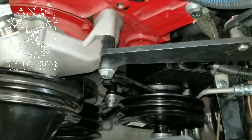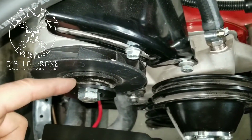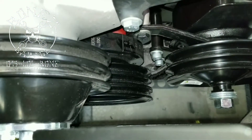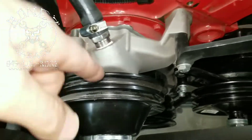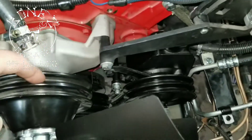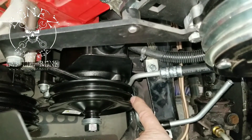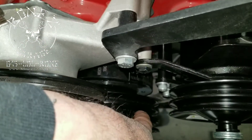The way this is working: the belt will run from the alternator pulley to the first groove on the crankshaft pulley, all the way down, then back around to the water pump. Then the second groove on the water pump will run out to the first groove of the AC compressor, down to the first groove of the power steering pump, and to the second groove of the crank pulley.